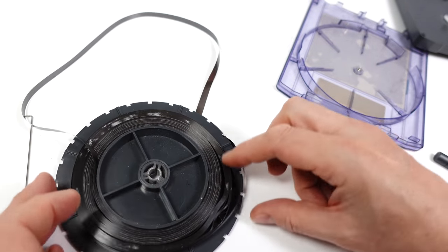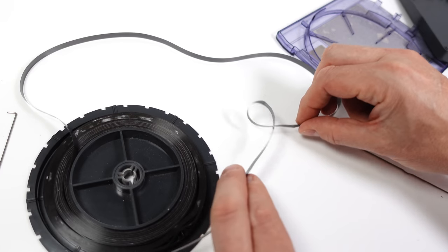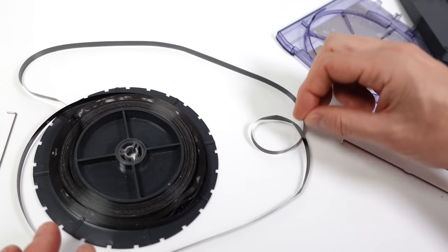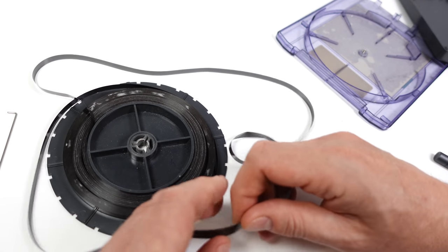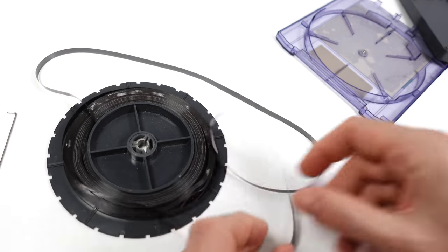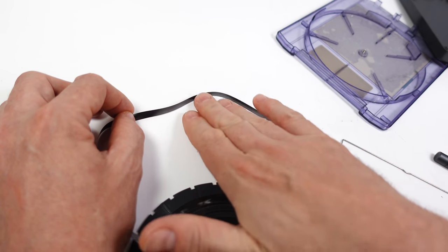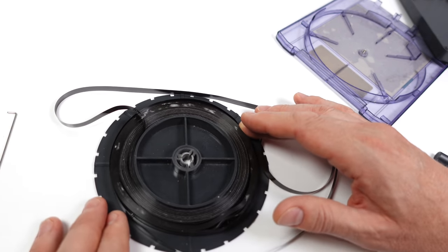There are a couple of complications — I'm going to have to splice this tape at some point and it'll no doubt be in the middle of a song, since there are four tracks and even if one's finished another will still be going. Also the tape plays back-to-front in a sense: in the Philips machine the tape head reads from the outside, whereas on a reel-to-reel the head reads from between the spools. So I'll need to spin the tape over and also spool it onto another reel.